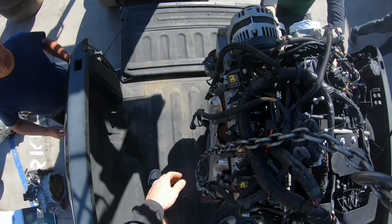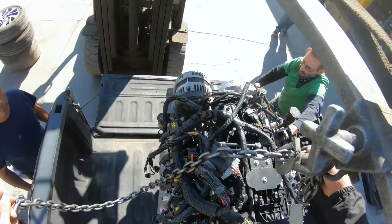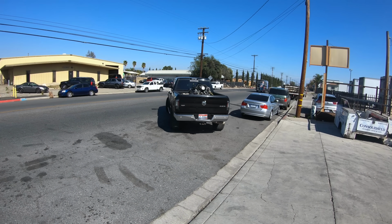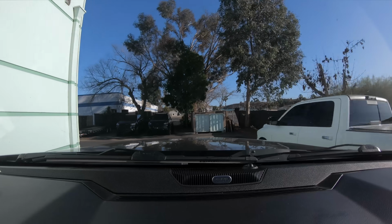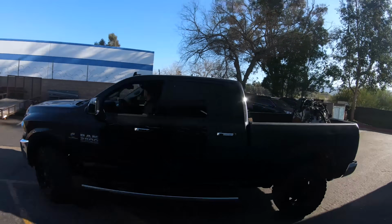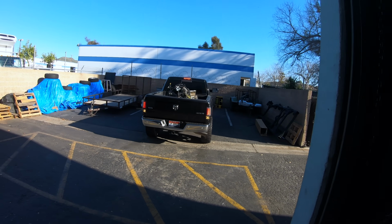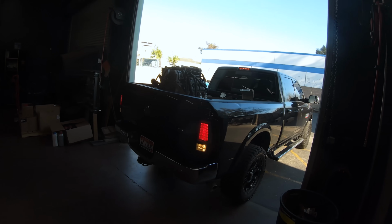The kit comes with a product called a Taser or a Blaster, depending on the application, which enables you to plug right into your OBD2 port and plug into your computer and do all the programming yourself. So we actually pre-program the system when we send it out to you, so you don't have to use your Taser, but we send a Taser with the system. So if you change anything like tire size or gear ratio or engine modifications, you can utilize that particular device. I'm reusing everything else except the motor.